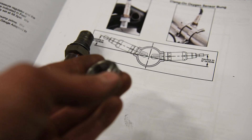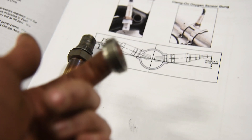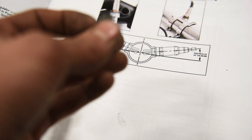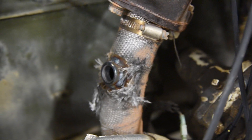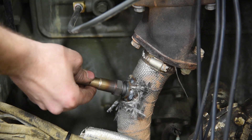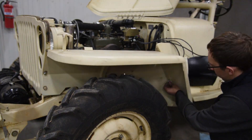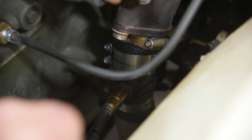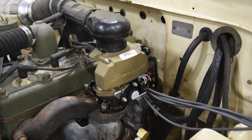This is the bung for the O2 sensor — it's just a piece of steel with threads that the O2 sensor threads into. Why Holley doesn't include this with the kit is beyond me, but you need to buy one of these to weld into your exhaust. There's a little lip around it that you weld right to. My O2 sensor is installed — got the bung welded in, got the exhaust wrap back on, threaded it in nice and tight. I also painted my fuel block-off plate.